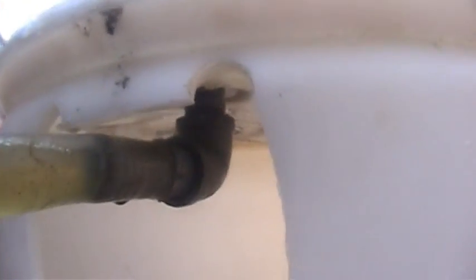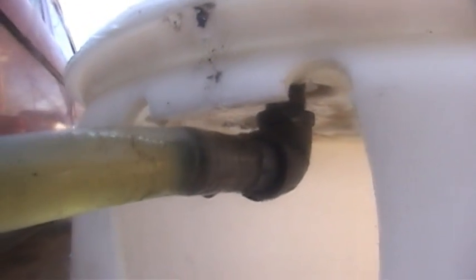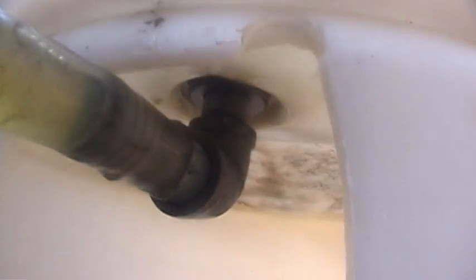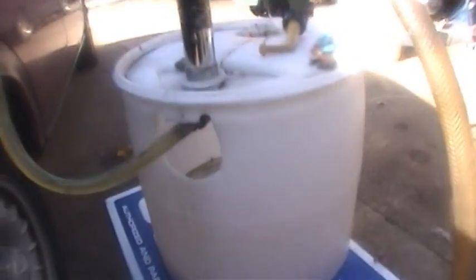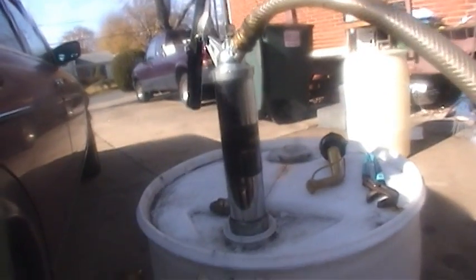And then that allowed me to put 3/4 inch pipe fittings going to a hose barb and just connect the hose to it. So now at the bottom of the pump, which I threaded for 3/4 inch pipe, it takes a 90 degree, and I simply cut a hole in an old tank I had, a half barrel, to mount the pump in. You could mount the pump on a stand or whatever.